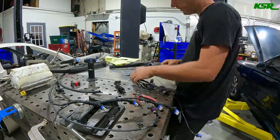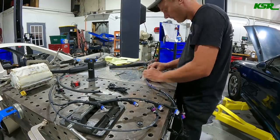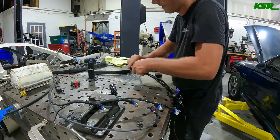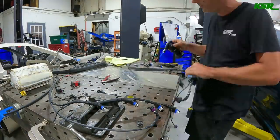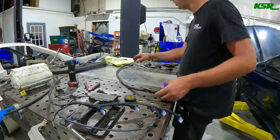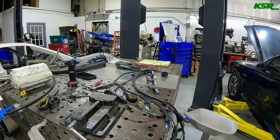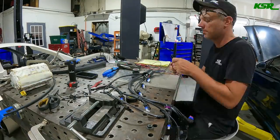What I typically do is put a Sharpie mark where the wires are going to come together — where I want to heat shrink them and step up the bundle — then come back on the bench and align those Sharpie marks to bring the harness together outside of the car. I've built harnesses on a bench a couple times and it worked okay, but when you're working on a single plane — like a piece of plywood or cardboard taped to the floor — you can't get all the angles just right. You end up with extra loops in part of the loom or areas that are extremely tight.